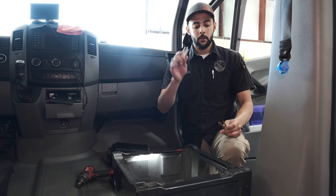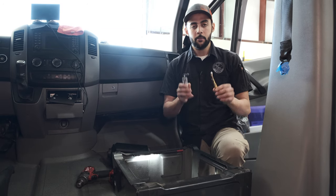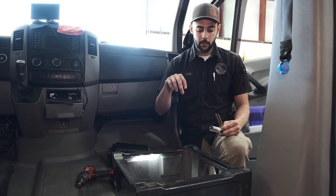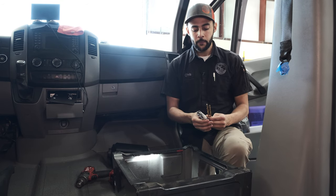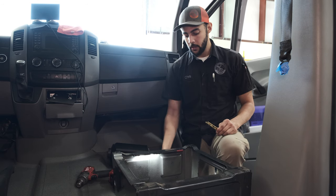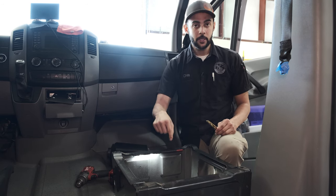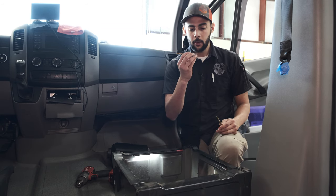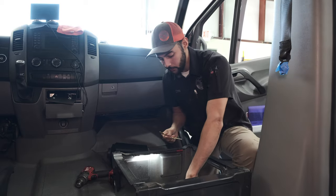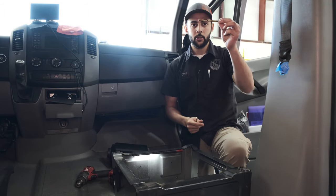The tools you're going to need to make the holes for your exhaust intake, through bolts, and fuel line: for the exhaust and intake, you'll need a one-inch hole saw; for the four mounting studs, you'll need a five-sixteenths drill bit; and for the fuel line, you'll need a quarter-inch drill bit.